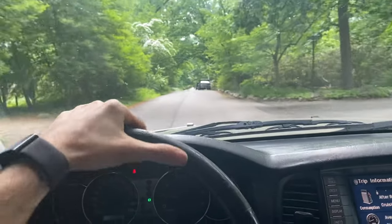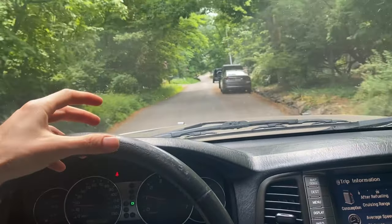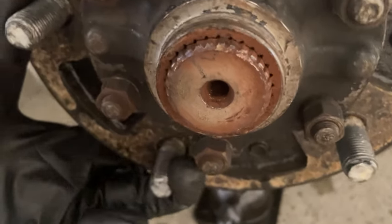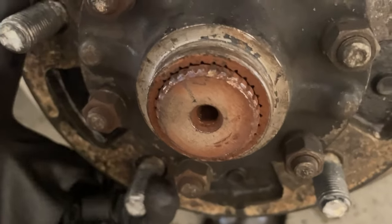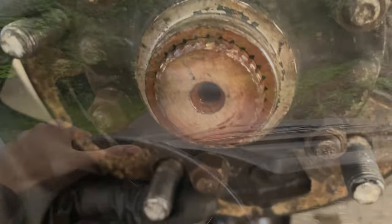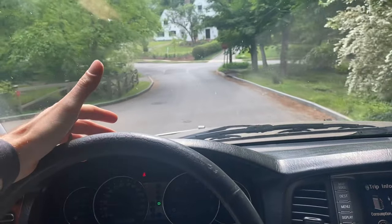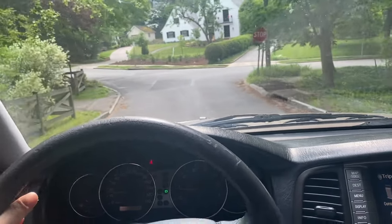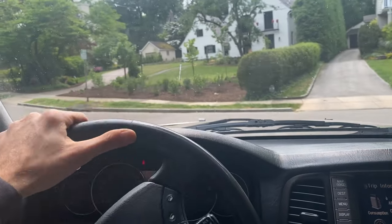Before I did it, I had a lot of play in where the CV axle meets the drive flange — those splines were pretty worn out. So there was a lot of looseness and chunkiness when you were going through the gears or accelerating, and when you put your foot on the gas there was a really big driveline clunk, like everything kind of slammed into place.